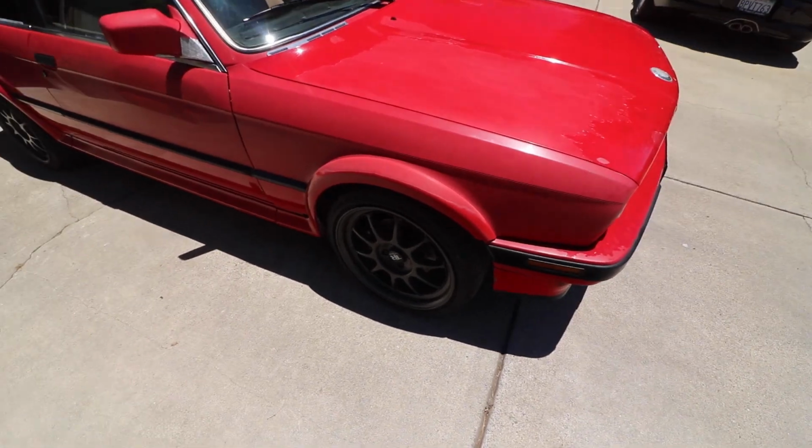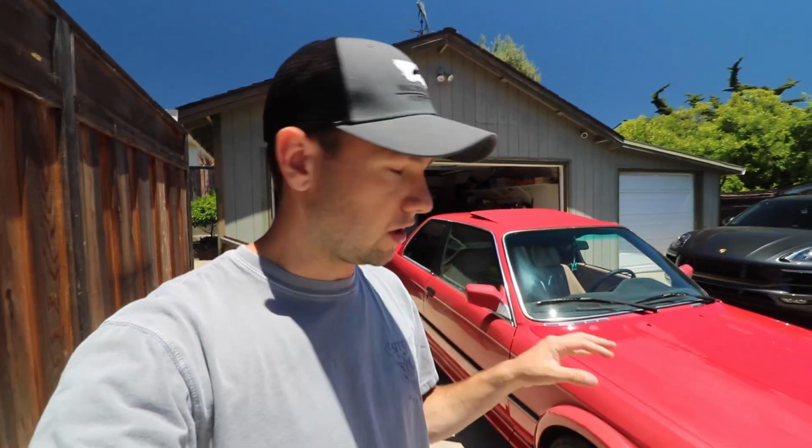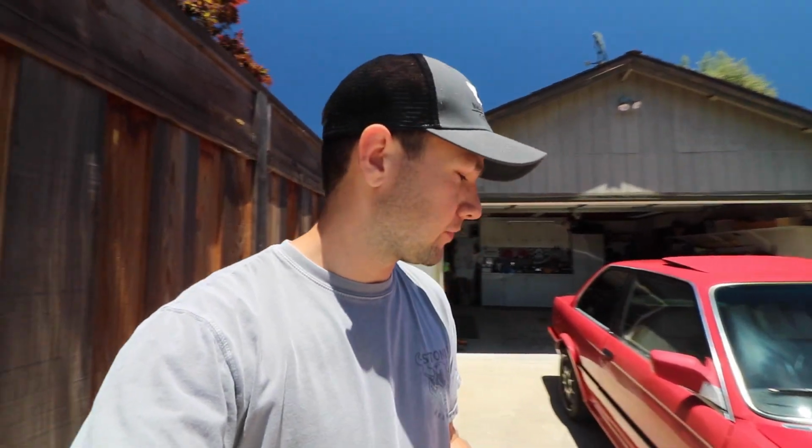So after putting roughly 50 miles on the car, I can already notice some huge improvements with the new brakes. It's hard to say if this huge improvement in the braking capability of the car was solely attributed to the new rotors and pads, but I think it's also a mix with the new caliper, because that front right caliper pretty much wasn't working at all. I was only running on the front left brake and then the rears. I think now that I do have even brake application in the front, the car just immediately feels way better. Also, these pads and rotors have a great immediate firm feeling when stepping onto the brakes. That also could be fresh brake fluid as well.